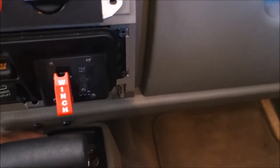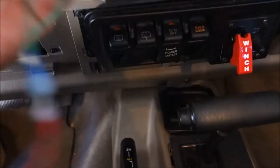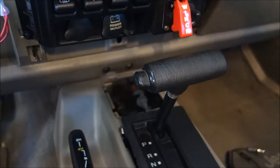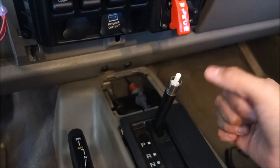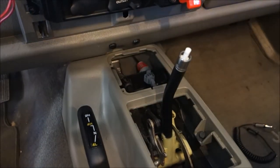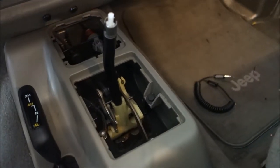I'm going to take this console piece off — just use your screwdriver — which gives you easy access to the inside of the console. To take off the shifter knob, all you have to do is pull up with force — do not twist. It pops off. Then use a screwdriver to pop off the next piece, and there'll be a bulb hooked to it. Twist and pull the bulb off. The whole thing comes off, giving you the opening to your console with a lot of space to run your wires.